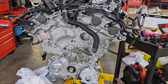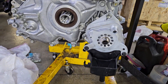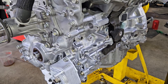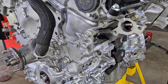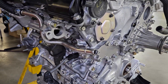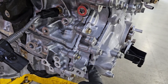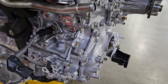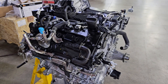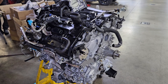Here you've got your oil filter housing - that's where your oil filter is going to go. It has an oil cooler going through it to keep the oil nice and cool. It's not a bad design. That two-piece timing cover I was talking about - you can see the sealant coming out of both covers as a nice little bead. You don't want a lot of smearing and bulging out of the covers - a nice little bead is how you know the right amount was applied.